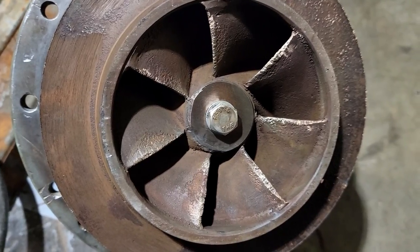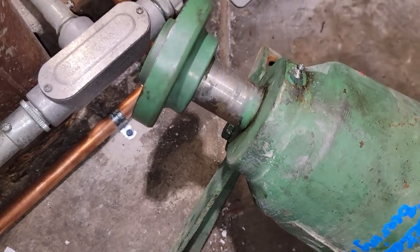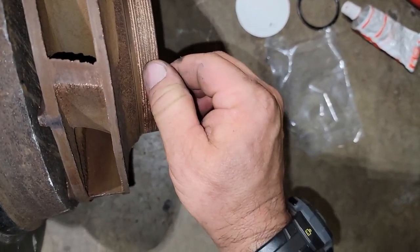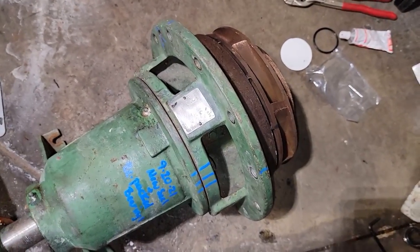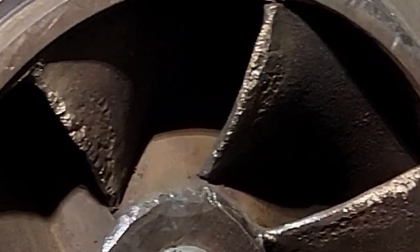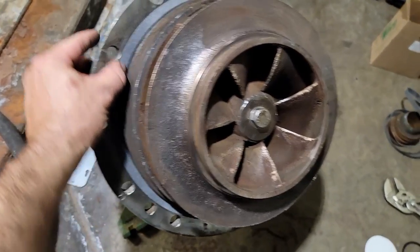Everything's clean. Just gotta shove it together and get it threaded on — nothing's hitting, everything's smoothly turning, feels pretty good. You can see in the past where it may have hit it — maybe that's the way they grouped it; it feels like it may have hit one time whether it be rust or what and kind of carved it up a little bit. This has probably been changed a couple times. I'm going to do what they did last time — add a little bit of high-temp silicone around the corners to help pull the gasket in place. It'll also make it a lot easier to get apart next time.